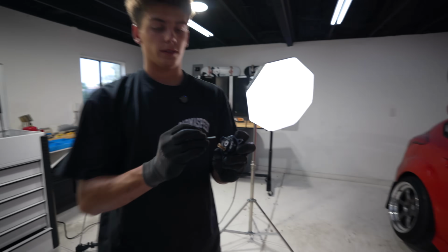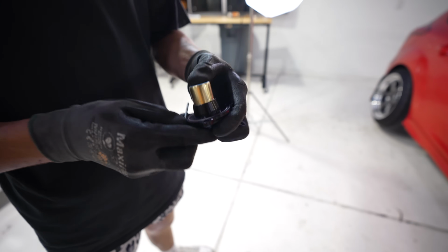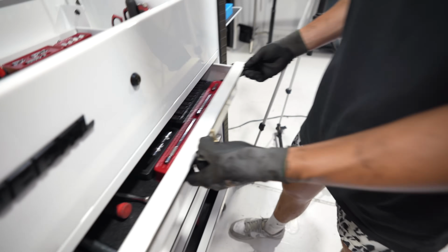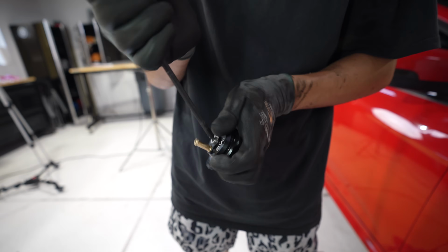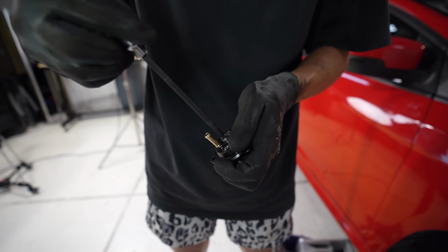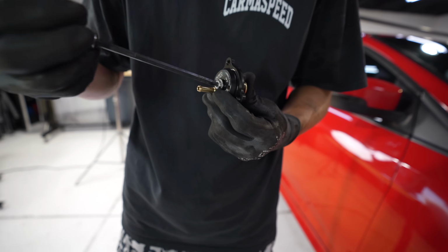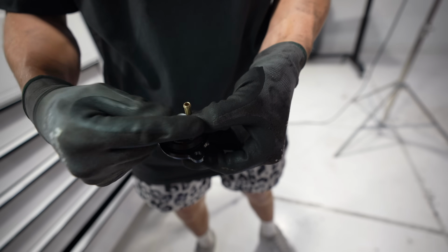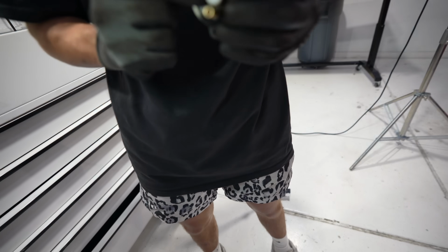Now we gotta take out this Allen to get this temporary tool in to pull the piston in, so when we put it in. So we're gonna unscrew that. Is it the same five? Try it. Yeah, maybe. 5 millimeter. So this is adjustable. So you can make the spring pressure a lot, a little. Yeah, it's holding that plunger.